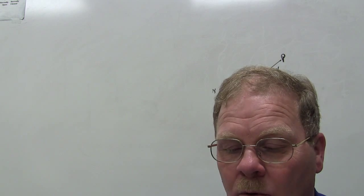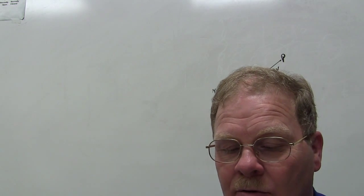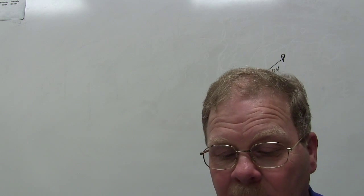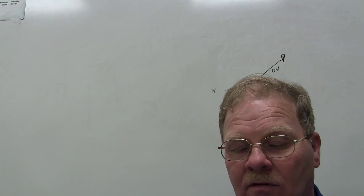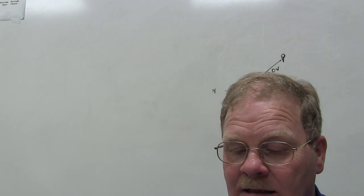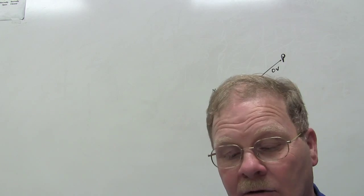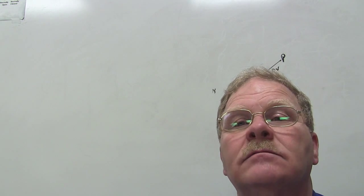The circuit breaker that protects a power window circuit opens when the window is lowered. Technician A says internal resistance of the motor is too high. Technician B says the window regulator may be sticking. That's B. The current draw of a window motor is being measured. Technician A says an ammeter can be connected on the power side of the motor. Technician B says it can be connected on the ground side of the motor. Who's correct about that?